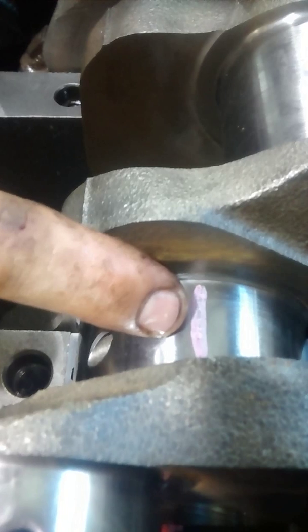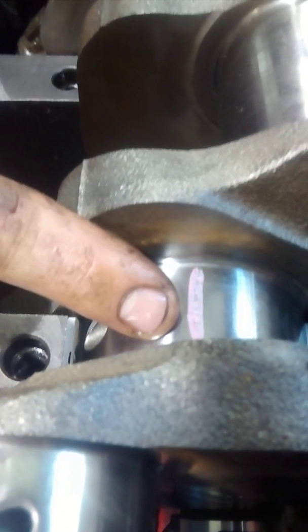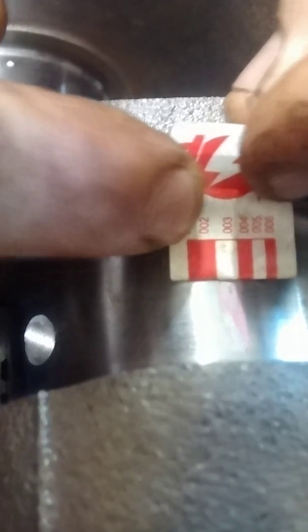Number two, as you can tell here, is right in between the three thousandths mark if you can see it there. All you do is find your line like this after you've taken your main caps back off. Your line there will wipe off. You always want to clean that off — if you do not clean it off, you've got some major problems. You can spin a bearing with that little piece that's in there. Our center cap, which was our first one, is just a hair bigger than three thousandths, which would put us at two and three quarters to two and a half thousandths of an inch. Then we go back here — this one is actually three thousandths. And our thrust bearing is right at three thousandths, which is acceptable.